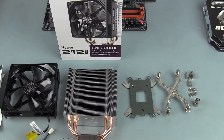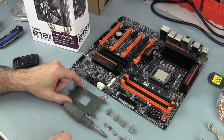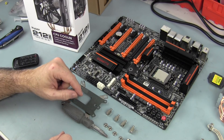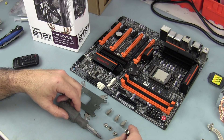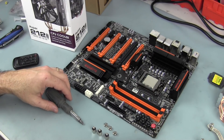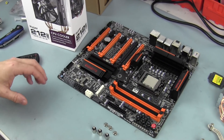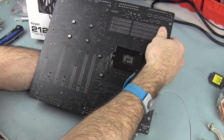To install the support bracket onto the motherboard, you need the support bracket itself, the four standoffs for the LGA 1155 or 1366/1156 setup — the only other set aside from the LGA 2011 ones — plus the four nuts that go with them, the tool they provide, and a Phillips head screwdriver. To install the bracket, we'll first put a couple of standoffs through the motherboard and then flip it over to align the bracket.